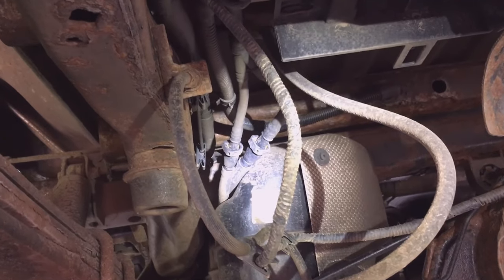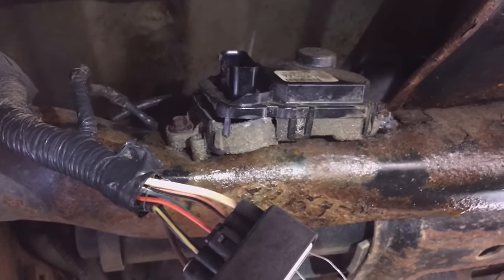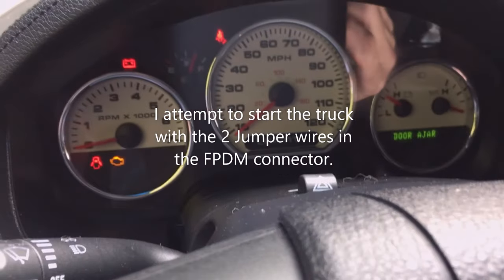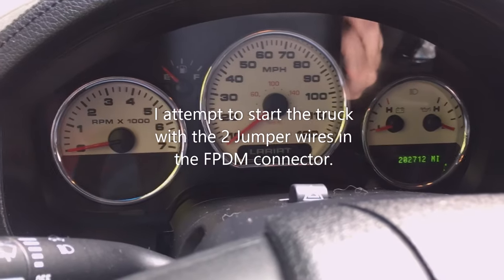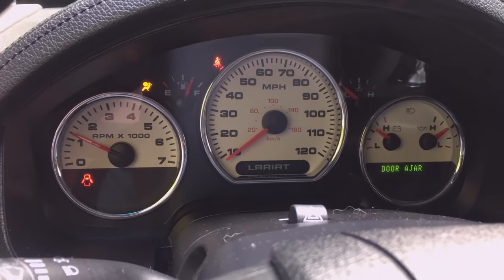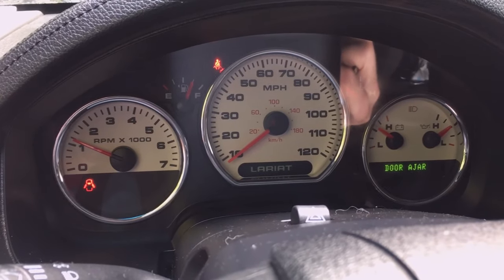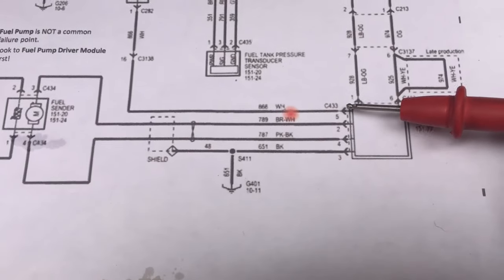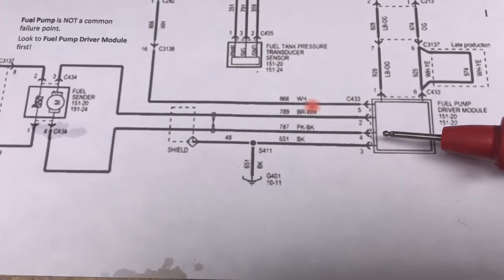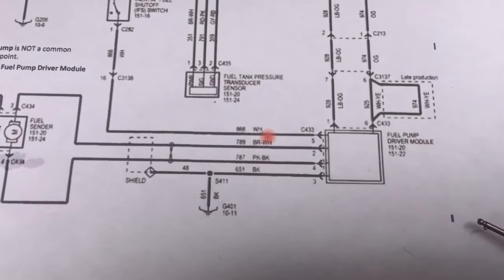With the key off, I insert the two jumpers and then turn the key back on — you can hear my fuel pump running now. Without a doubt, this damaged fuel pump driver module is bad. Back at the key — the fuel pump is still running. Shut it off and prime the pump one more time — the pump's back on, and it starts. You can hear my right-side exhaust manifold leaking; it leaks for about 30 seconds until the truck warms up. With the jumper installed, my fuel pump runs — so without a doubt this fuel pump driver module is bad.